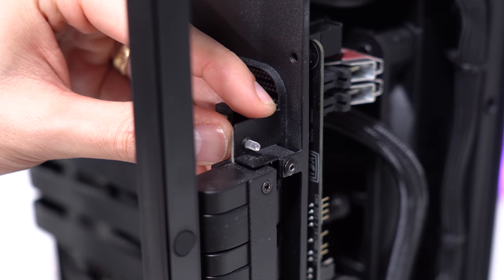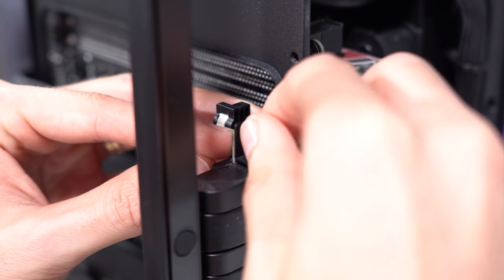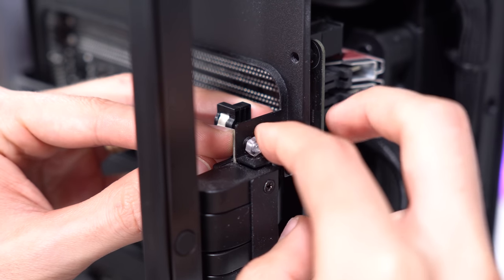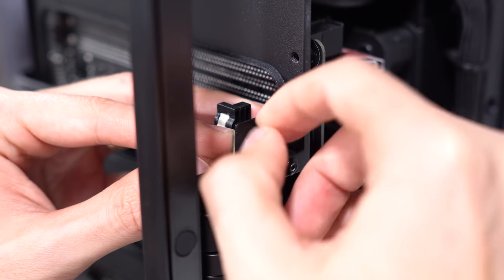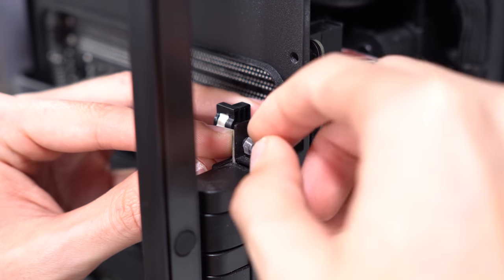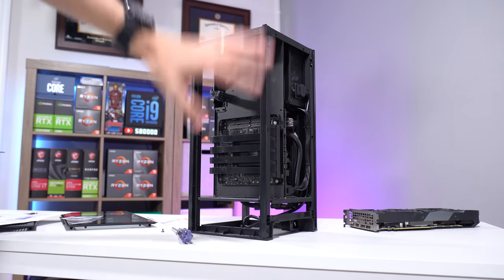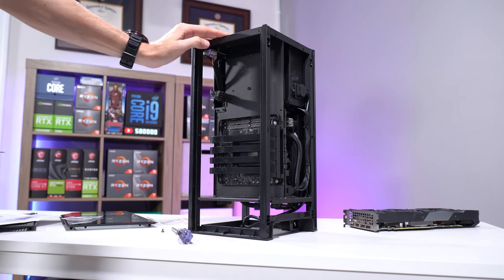You can see the threads just slide right through, then you want to use this nut. I'm going to hand-tighten it — I'm not going to tighten any further than that. At the end of the day, the card being locked to the chassis is what's going to keep this thing rigid. The riser cable is not going anywhere. With the graphics card still out, I'm going to take my electric duster and get rid of this dust to clean the system up before we give it back.